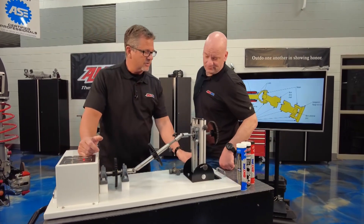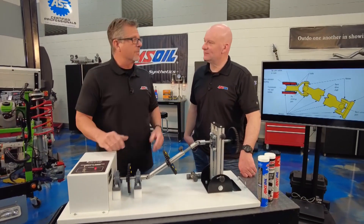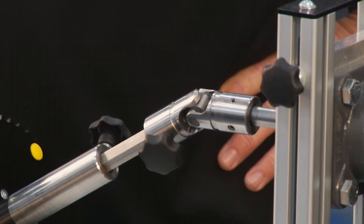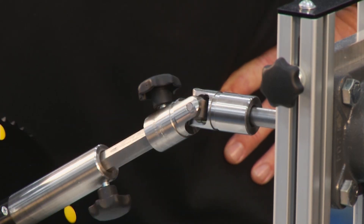All kinds of issues with drive shafts — you can see it on the screen. Leaks, wobbles, all kinds of things going on. When we talk drive shafts, you're talking about grease. You've got to have grease in these things because of the U-joints and the way they're transferring the power. There's flex going on inside the U-joint with those needle bearings. They require lubrication.